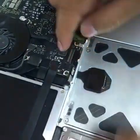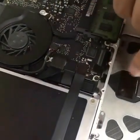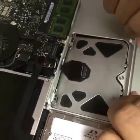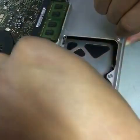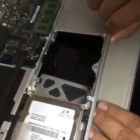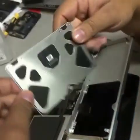And if you want to switch the flex, you could too. We're going to remove this latch right here — it's very simple. Now we're going to remove the mousepad track. It comes right off when you lift the bottom part of the computer. Here's the flex cable, and we've got the mousepad track right here.